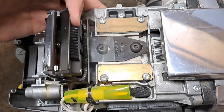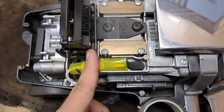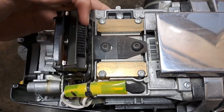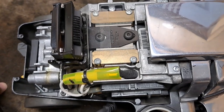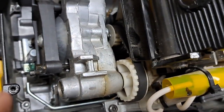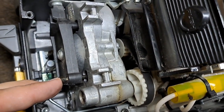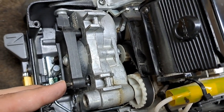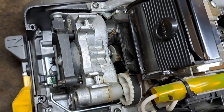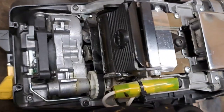This is a really tight forward engagement, but the problem is now the reverse is weak. You can actually hear the slide hitting the back of the frame. How do you fix that? It's actually really easy — you can adjust the reverse using these two screws here. I'm going to tighten those up; it probably won't take much, maybe a half turn on each screw to tighten up that reverse.